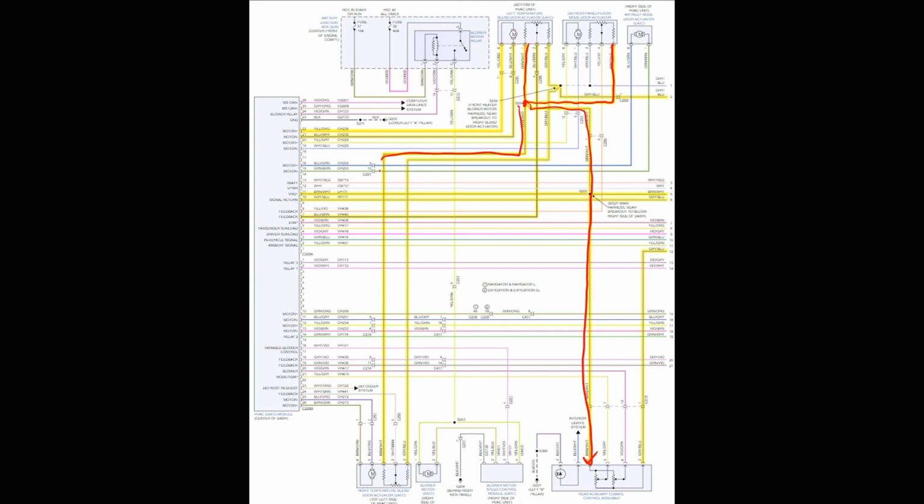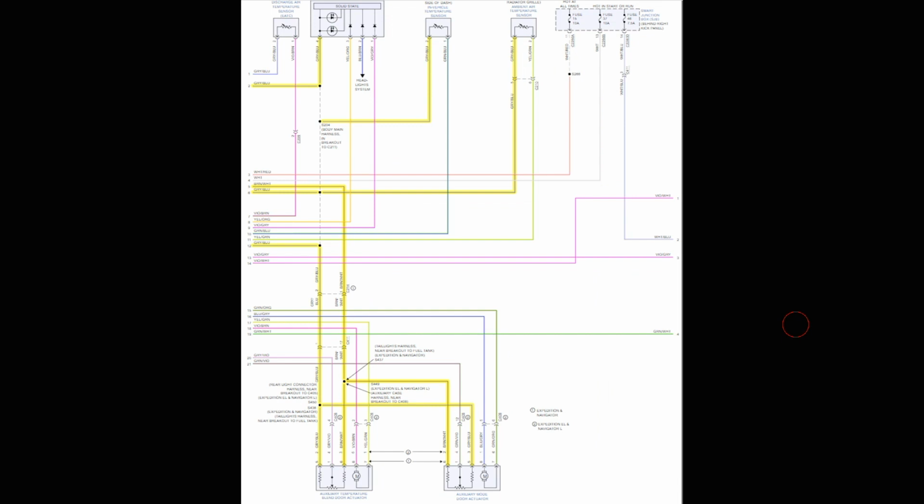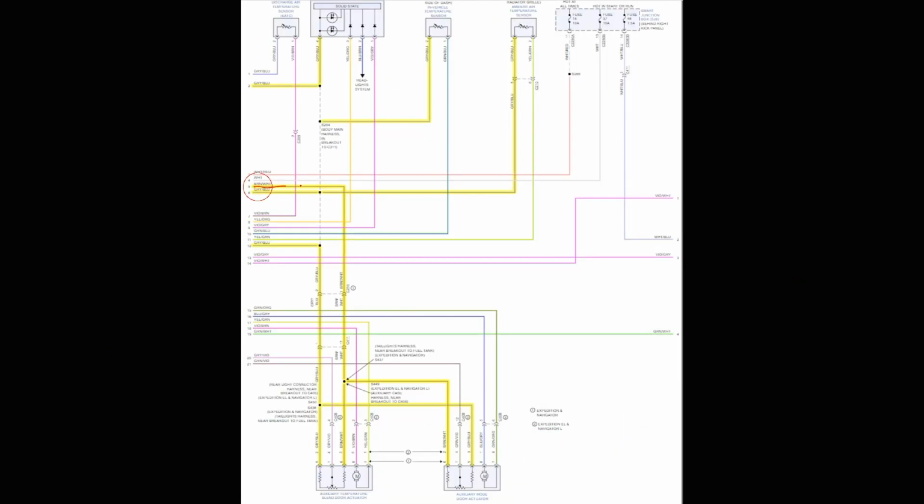Another splice comes down here. This is part of the right temperature blend actuator. That's the right, what's this one? I can't read that. So anyway, multiple circuits. Which one is that? I'm not sure yet. Following it this way, again, forget that. You can't see any of that. It goes off the page. Next page. What color was that wire? Brown, white. Brown, white comes down here, splits, and goes to two more. That's the auxiliary door actuators. Two more potentiometers. All right.